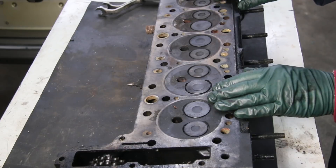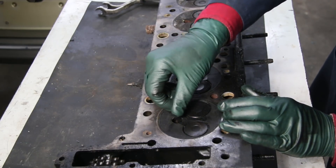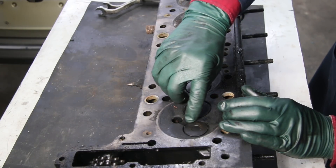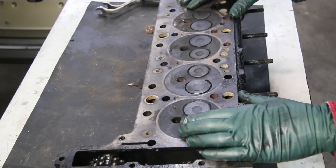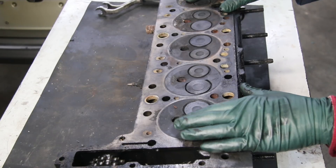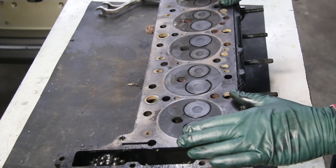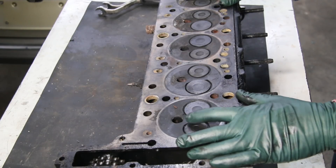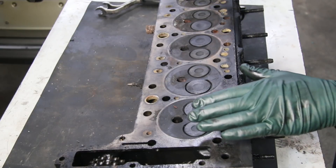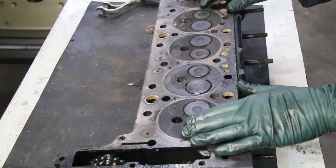The final alert concerns cracks in the cylinder head. These cylinder heads will crack and the cracks will be very small. Most cracks are found either between the pre-chamber hole and the valve seat, or between the two valve seats. They'll expand when the engine is running. You'll start your engine and it runs okay, then pretty soon you start to see white smoke or unexplained coolant loss. A radiator pressure test can often indicate a blown head gasket but can also indicate a cracked cylinder head if the crack is in an area where there's a coolant passage.